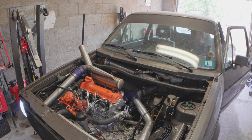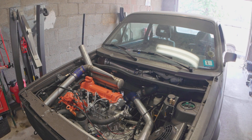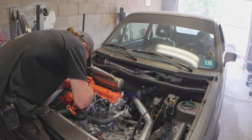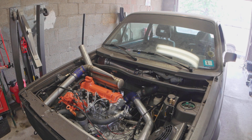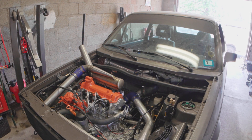Okay, so the idle is exactly the same. Fascinating. No change in idle, which I guess makes sense — your pump is ultimately what's deciding how much fuel is injected at idle, and small injectors are completely capable of managing that amount of fuel, so it makes sense that when you put bigger injectors on, nothing really changes. However, it was not running terribly happy right there, and I would tend to blame that on it being cold but also injection timing. Pretty sure I slowed this down, so I'm going to go ahead and advance the timing back to where it was and we'll see if that makes it better.